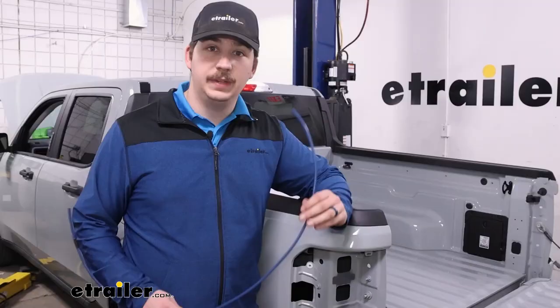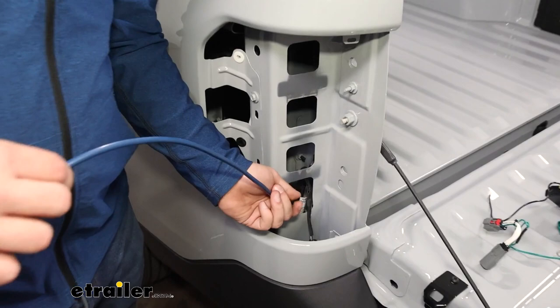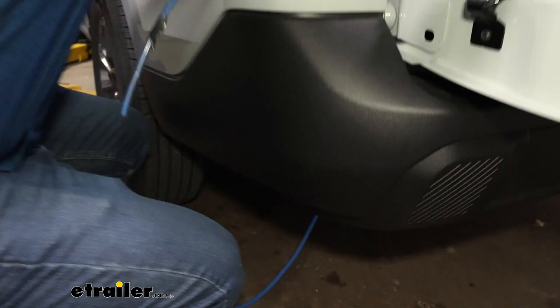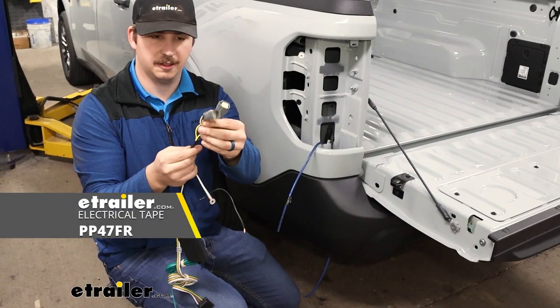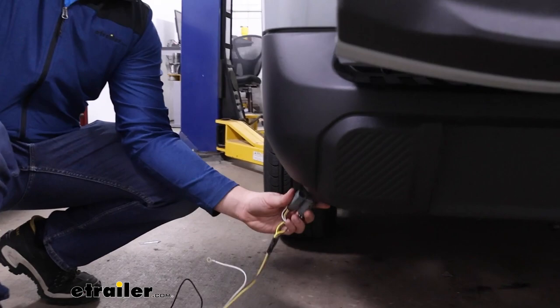After you've completed that, on the other side you can grab a piece of airline tubing, wiring, a coat hanger — whatever you need to use to fish wire down through this bottom hole, and you'll see it pop out underneath the vehicle. In person you can just look right down through and see the ground. What we'll do is tape the end of our custom connector with the yellow wire to the end of this and pull it up through so we can connect it up top. Once this is wrapped up, we can start to feed it back up to our spot where we had our taillight.